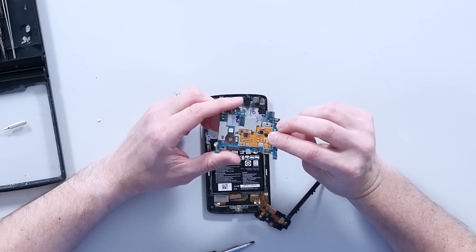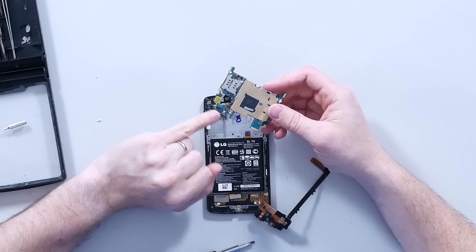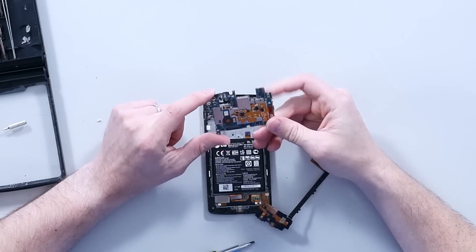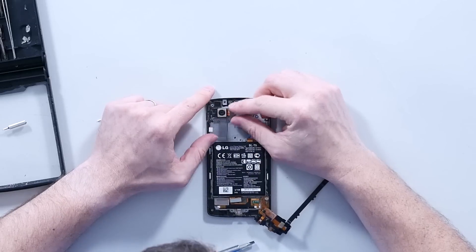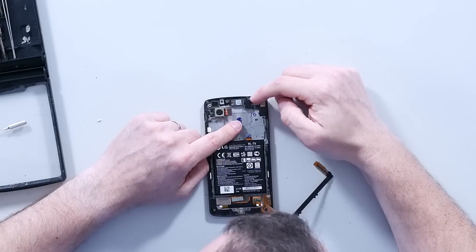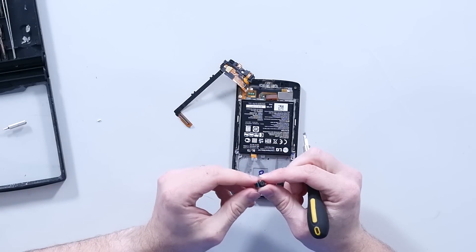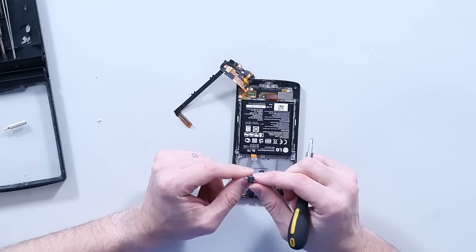Also integrated onto the main board we've got this little IR gate, which is a proximity sensor that knows when the phone is up against your head. In really low light, if you look closely, you'll spot a little infrared LED which shows up as a tiny pink glow. We've got volume and on-off switches on board as well. But because everything's integrated into that single package, there's really not a lot to see. There is the camera module, a speaker, a headphone jack, and the front-facing camera on its own little daughter board. Just the tiny little camera module — the envelope in which they can get a lens and a sensor is just incredibly small.